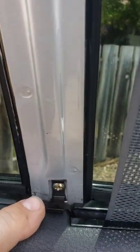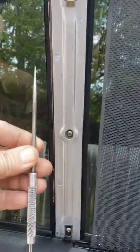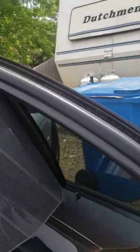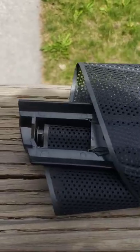There's a metal clip that holds them in and they just snap down over this little metal tab right here. If you reach underneath the plastic piece and push up — I used a machinist's pick, a scribe — that's how I did it. You're coming in from the trailing edge of the door, bringing your machinist pick up from this way. You just have to kind of feel around for it.